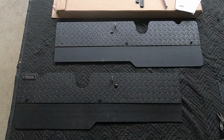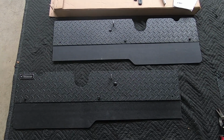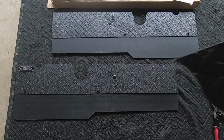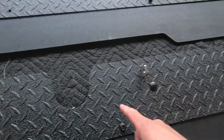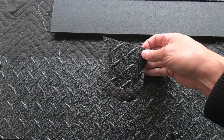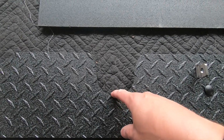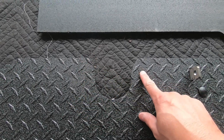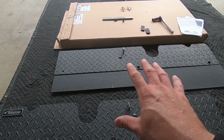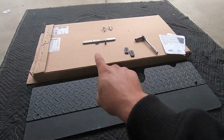All right, so I have both of the mud flap sides prepared for my test fit, and then to figure out how much I need to trim off there. So this is what pops off of the flap once we install the bracket, and then you have 3 little pieces that you cut. So you cut here, and then just take the whole piece itself and just bend it, and the metal fatigue will eventually just snap it right off. So we have our factory cut out. Again, if you have factory exhaust, this is where you finish up with the modifications, and then you're good to go to install it once you get these guys spliced into each other, so using that bracket there.